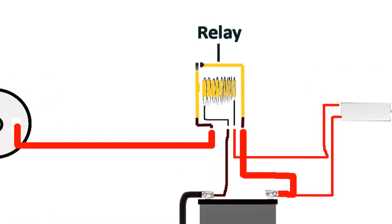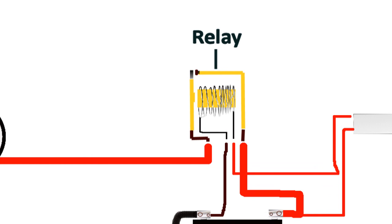Let's go back to the relay and have a closer look. The relay is made up of a few different parts. In the middle is a coil, and the job of this coil is to create a magnetic field. That piece of metal stuck through the middle of the coil becomes a magnet when you put a current through that coil. The magnetic field created attracts the latch plate. When you put a current through that coil, it attracts that plate and this gap at the top here closes up, closing the circuit. The actual latch plate is spring-loaded, so once you've taken the current away from that coil, it will just spring back into the original position - it won't stay where it's put. So now you've got a basic knowledge of how the relay actually works.